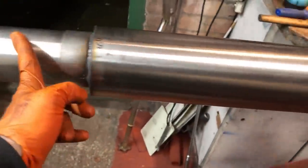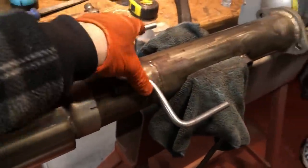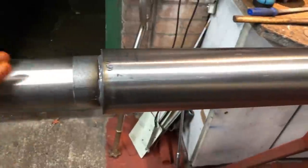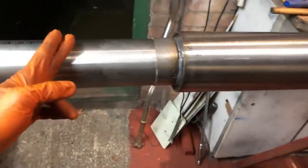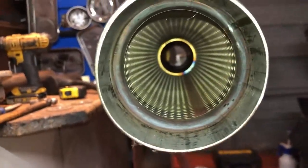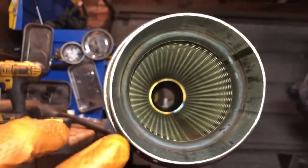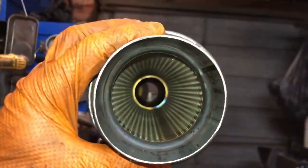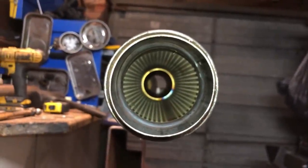I've made up a section and cut it so the total length is 25 and three-quarter inches. There's no need to test-fit on the car because these sections bolt up in place and these ones are circular, so as long as the length measurement is right it will slot in perfectly as before. Looking inside the design it's going to be perfectly free-flowing, and hopefully these baffles will stop the resonation issue. It's a common problem on three-inch exhausts — you get a drone that you don't get as much on 2.5-inch.